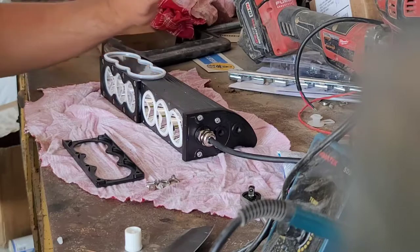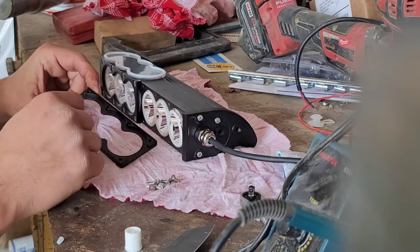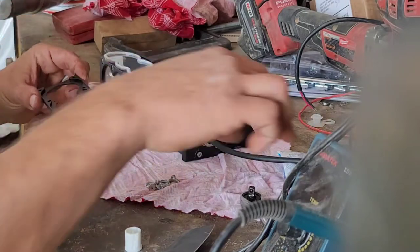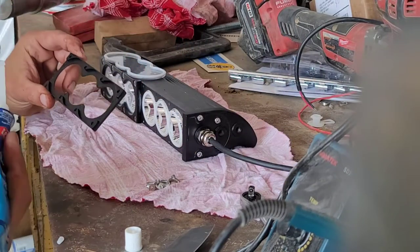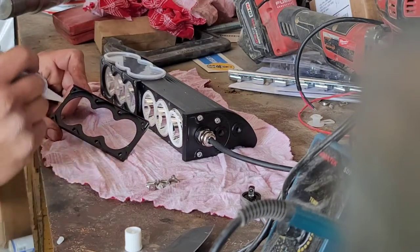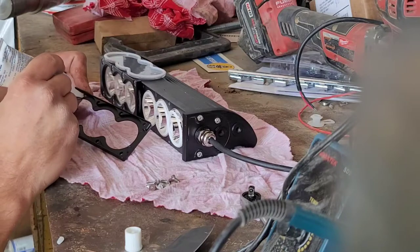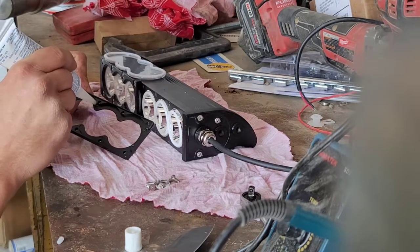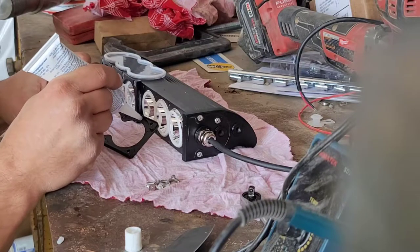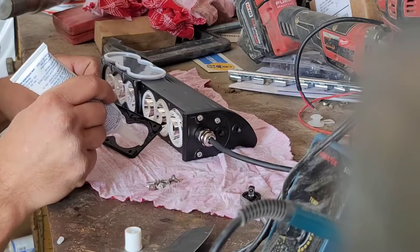What we're going to do is put a really thin layer of silicone around here, then attach the lens to the cover, then go around the outside of this inner gasket just inside all the screw holes, and reinstall everything. First we'll get our light lens put back on. I just cut the very tip of the tube off and work it in as I go rather than laying a bead — that makes sure it's getting down into the surface. The key thing here is you do not want to use very much silicone, because the squeeze-out will obstruct the lens if you use too much.